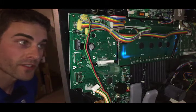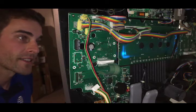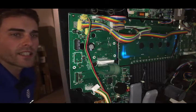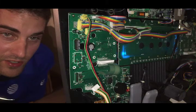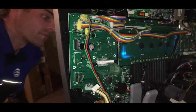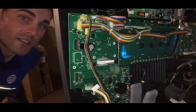If the capacitor hadn't exploded and just kept rebooting over and over, we were about to give up on it and I probably wouldn't have figured it out — aside from just replacing capacitors all over the place on a whim. But it's fixed. It's a 6800 microfarad 16-volt capacitor. So if you have a rebooting issue on a NordicTrack treadmill — this one is about 10 years old — I would start by replacing that capacitor. Good luck to you.